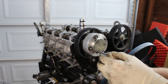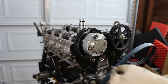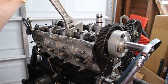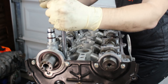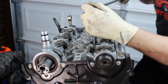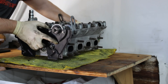If you have a VVT engine, first remove the T25 bolts on the front of the intake gear — be very careful because these are made out of what feels like melted-down Coke cans. I keep telling myself I'm going to replace them but keep reinstalling the old ones, lowering their health bar slightly with each use. Use a crescent wrench to hold the cams in place while you loosen the cam gear bolts, then remove the gears. The head bolts need to be loosened using an inward spiral pattern starting with the outermost bolts — the exact opposite of the torquing pattern. Once all the hardware is loose, remove that powerhouse from the cylinder block and set it aside.